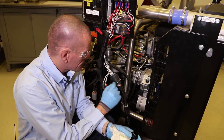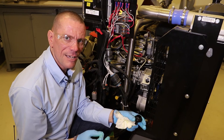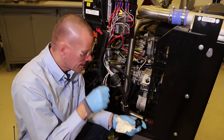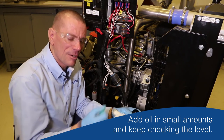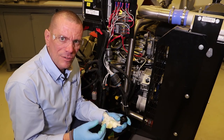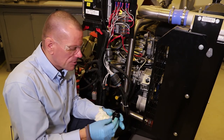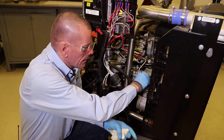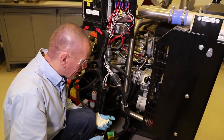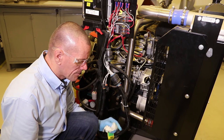Since there's not a big difference between the top and bottom marks on the dipstick, we want to be very careful not to put too much in. Do lots of small amounts and keep checking rather than one big amount and risk overfilling. On this engine I'd put about 0.25 of a litre - a quarter of a litre - in at a time, pour it in, give it a few seconds to drip to the bottom, then check the dipstick periodically as the oil runs into the bottom of the engine and see how it raises up.